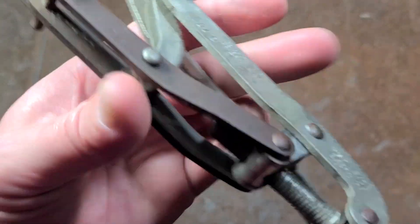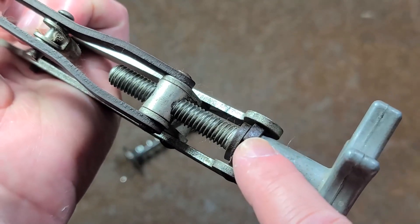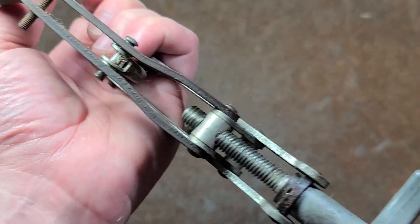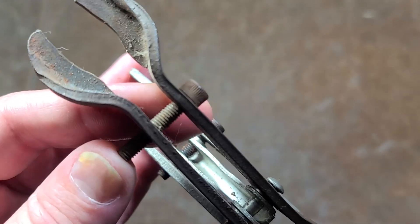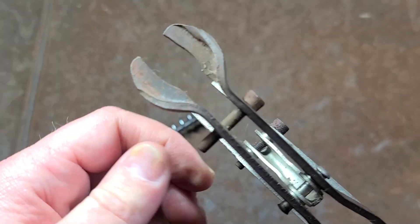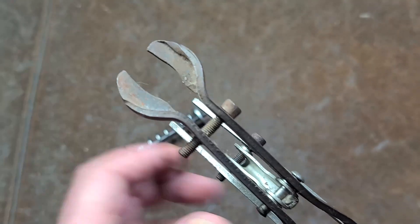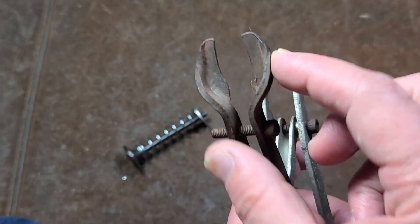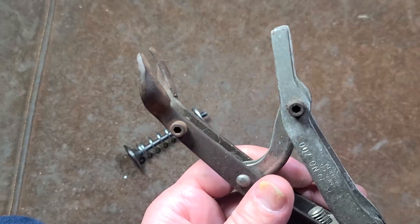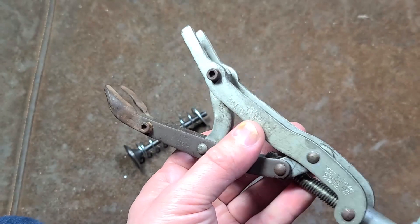It is pretty intelligent. When you're under tension doing compression, the force is between the handle and this plate. This little washer is just to keep the screw from falling out when you're actually loosening it back up. It has a neat feature where this screw either pulls these together, or if you loosen it — it's a little bit rusty but you can usually do it by hand — it allows you to adjust the width of this fork, which is not super common. You can adjust this so the bottom of the spring sits right in these pockets, nice and safe. You can tighten it to narrow it for smaller springs or widen it for larger springs, say on a diesel engine.